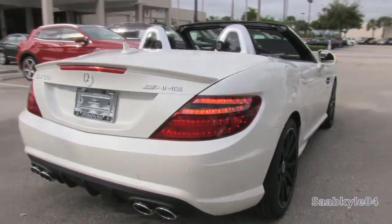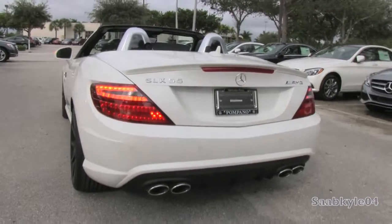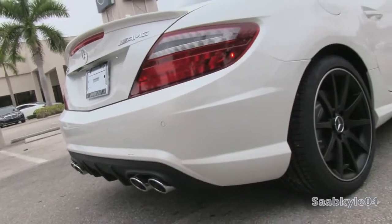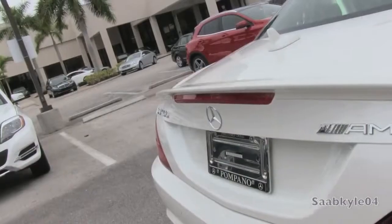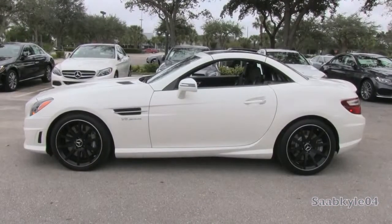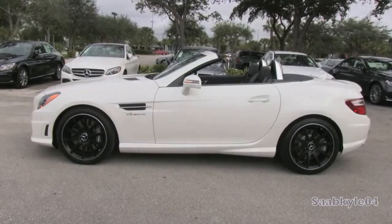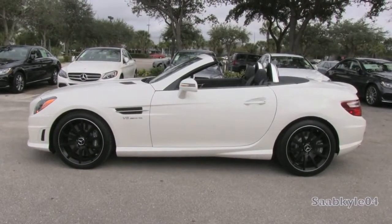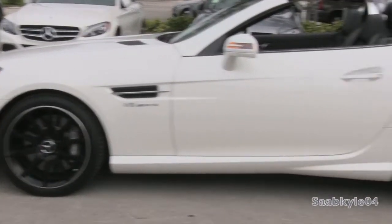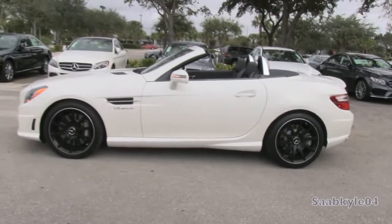You'll likely notice a slight change in exhaust note, but not much else aside from the Eco 4 displaying on the instrument cluster. With 170 pound-feet of torque still on tap, there's still enough reserve for light acceleration, especially keeping up down the highway. Of course, like the Eco Start-Stop feature, everything can be totally disabled by just the press of a button. Overall length is 163.2 inches with a width of 79 inches including the mirrors and a height of 51.2 inches with the top up. Wheelbase is 95.7 inches with a total curb weight around 3,583 pounds.